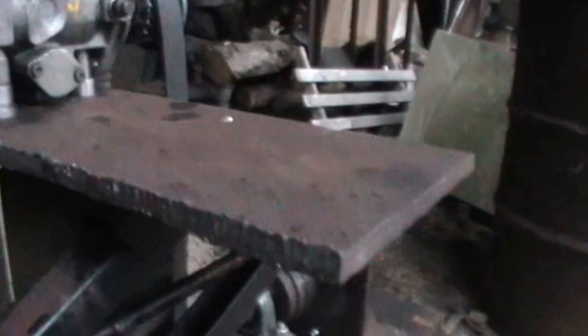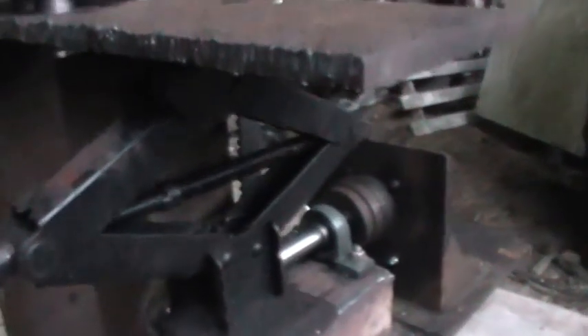To put the pump on, it's hinged at this end. I've just got an old screw jack here, and as you can see, we can just take the belt off and take the pump off — no problem. When you fit it back on, you just put the belt back on like that and tension it up.